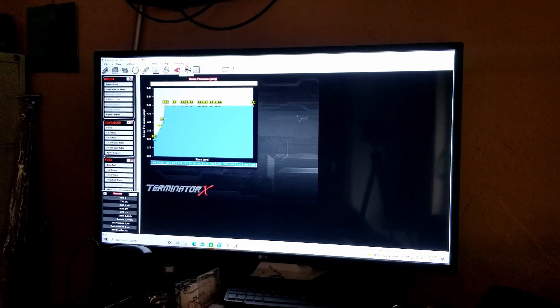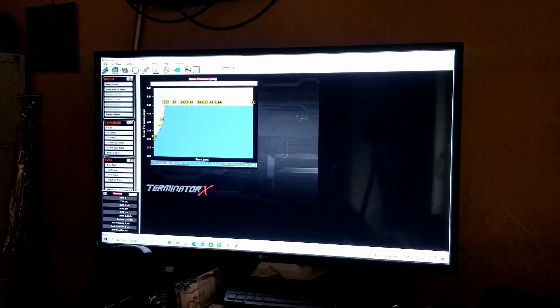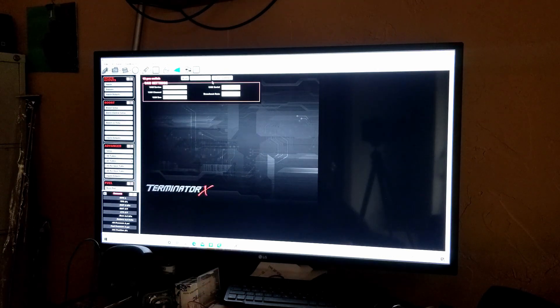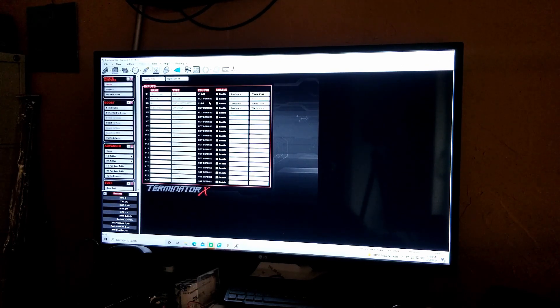How I personally have this wired: I'm using a CAN IO module. In the IO settings, it's number four — '12 pos switch CAN 5 volt.' You configure the CAN stuff just like everything else. The CAN IO setup has a 5-volt out and sensor ground, so you can run the switch signal right to that along with your input. That's how mine is set up and it's working well.